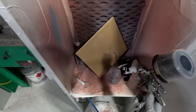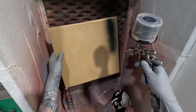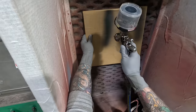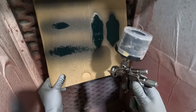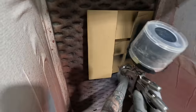Because I was so unhappy with the results I was getting at the start, I decided to get some black paint and do some test sprays. This is the best way to identify any faults in your fan - get black paint in it and some cardboard or masking paper. The black paint will highlight issues better than any other color. Hold the gun straight and see if you're getting top-and-bottom heavy, middle heavy, or whatever it may be.